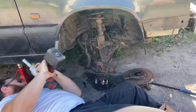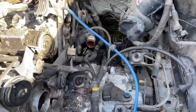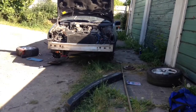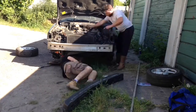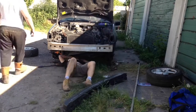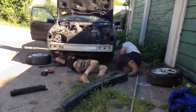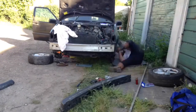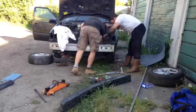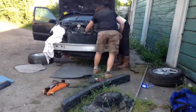Here we have the Volvo Wizard working on the subframe — we have to partially drop the subframe so that we can get the gearbox out, which is basically all of this lot to come out. To get the subframe down a little more necessitated wiggling the car around and getting it a bit higher up in the air. But once that was done, it was just a long slog to get the many 14mm bolts that hold the gearbox to the engine out, including two real pain in the arse ones on the starter motor that were damn near impossible to get access to. In reality we didn't work straight through as it looks — we may have taken three or four tea breaks. It was a hot day. We bit by bit slowly got there, and as you can see we got dirtier and dirtier as the montage went on.